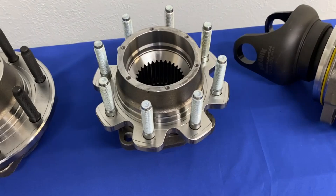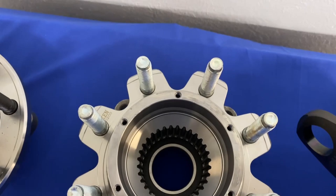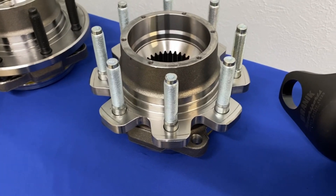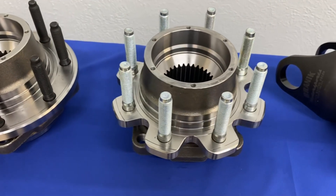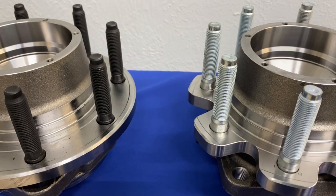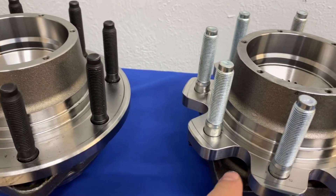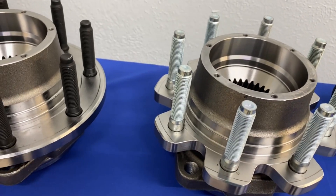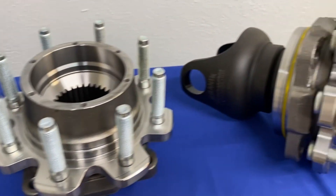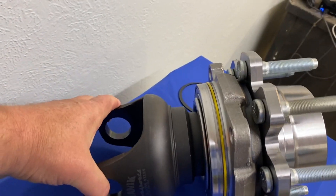Keep America strong. Here is our lightened and converted 8-on-6.5 wheel hub — fully machined, a little bit lighter. Look at the two studs here: the 14 millimeter versus 9/16. What you really get is this weird small base on the factory stud versus an actual large base here. I just prefer that my wheels aren't strictly relying on the hub centric.